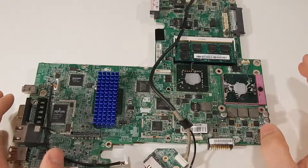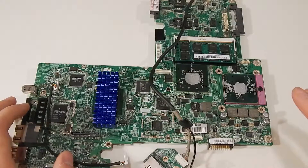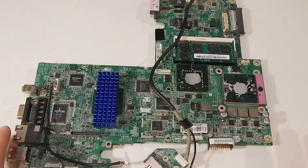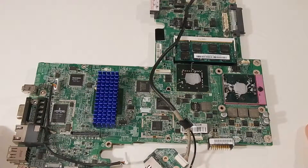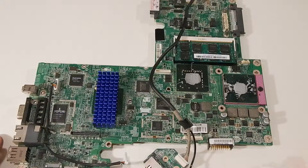It'll take like 4 gigs of RAM, so this could be turned into a fairly decent little low-powered desktop. I was thinking maybe if I put a cooler with enough thermal mass on here, I might actually not even need a fan. If I just get good ventilation throughout the case, I might be able to run this thing entirely passively. I concluded that's probably going to work if I use a stock AMD cooler and sandwich it on top of the CPU and the Northbridge, having it contact both of them. This thing ran stable in the BIOS and was able to go through memory tests and full hardware tests on it.